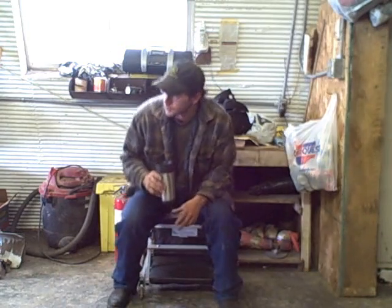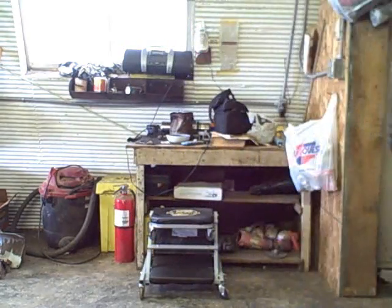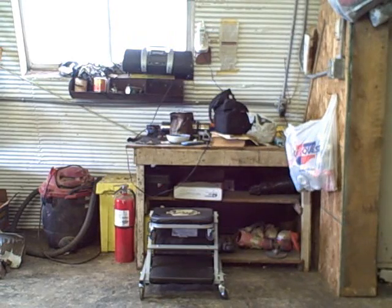And anyways, first thing I got to get done. We haven't been driving the Jeep for a few days. We got a wheel bearing going out on the passenger side. I think I might have mentioned that before, but it just got to the point it was making some noise, and I needed to address it. So I got some wheel bearings and seals and 80/90, and we're just going to flush out the rear end and put some wheel bearings in it. So onward ho, as usual, holding up progress.